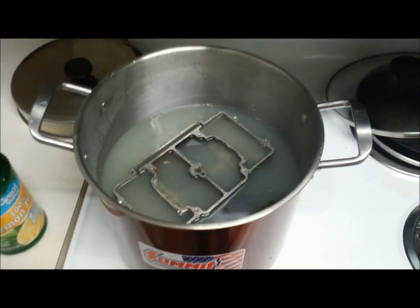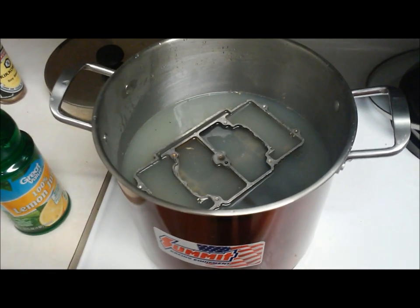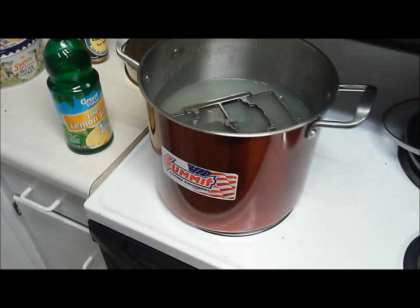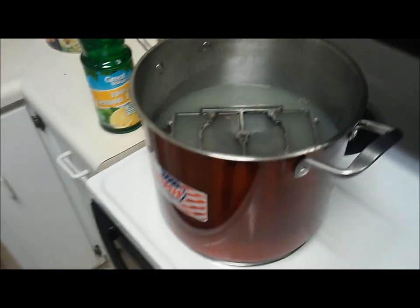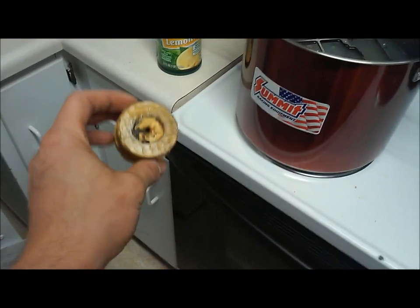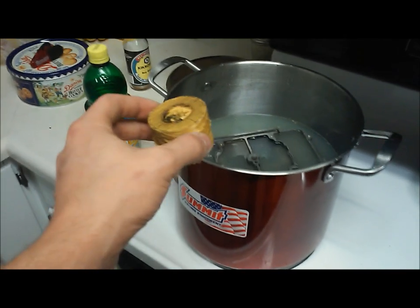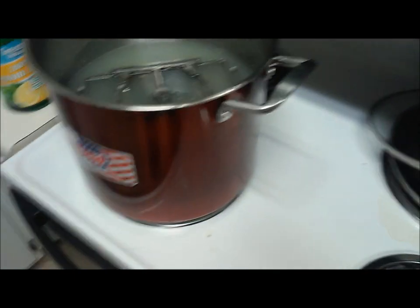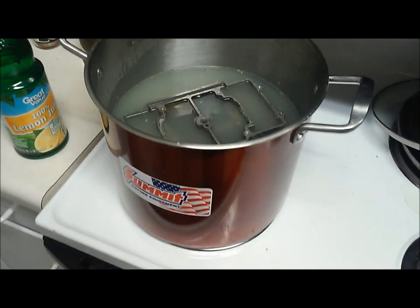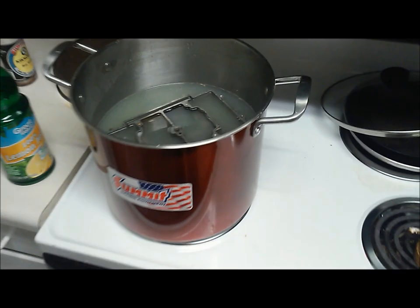I was considering that the carburetor might be sitting at the bottom of the pan where it's significantly hotter, which might induce a warp. Really you don't want the carburetor hot — just the liquid around it. So what I did — this is why I never throw anything away — I had these pieces of two-by-four sitting outside from when I made my bicycle generator. I cut holes in them and they work really well to set under the carburetor, separating it from the floor of the pan which is the hottest spot. So we're just getting the effects of the boiling.